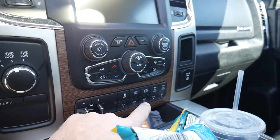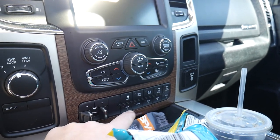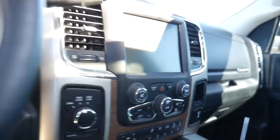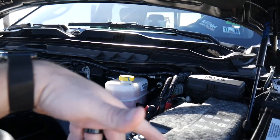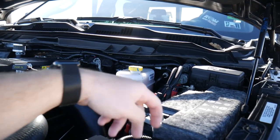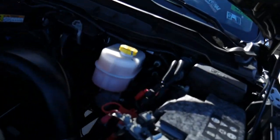Now, each one of these has different amperages, but they're all relayed and controlled through the PCM or the ECU in the truck. So I could program these switches to operate on ignition, battery, momentary, or latched. So it just makes life so much simpler. Like I said, they're already fused and relayed. And then these come out of the upfitter switches, and the lights hooked into the underglow, the wheel wells and the backlighting are all fused again going out. So is the spotlight, but that's a separate fuse on that actual wire going to the light. So it's a very clean installation.